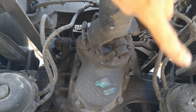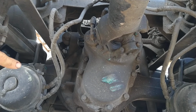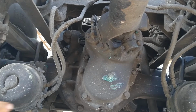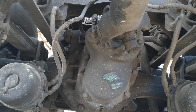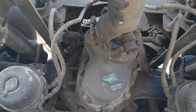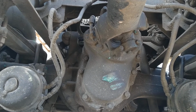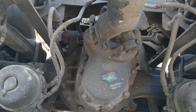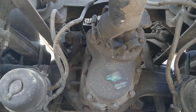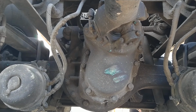Then I was able to let go of the left-hand chamber, go over here, and myself put a nut and washer on the right-hand one. Then put the bottom nuts and washers. And then with the ratchet wrench, a nice 15/16 gear wrench, which was so much easier than a regular combination wrench, one little eighth of a turn at a time or quarter of a turn at a time, I was able to use the ratchet wrench and turn it up, and then double wrench to get them nice and tight on the top, then impacted both bottom ones.